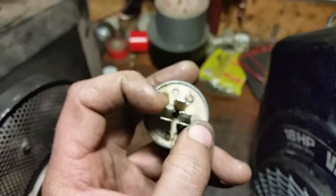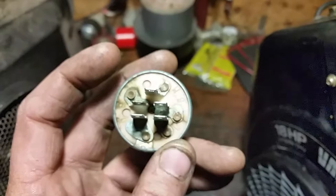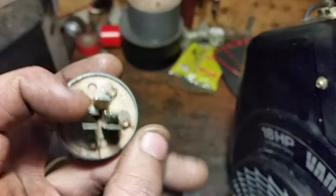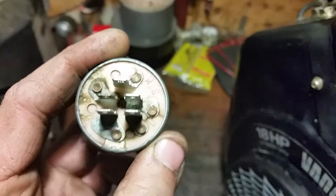What happens and where the problem lies is, while this is fine for the opposed cylinder engine, when we go to start up a Vanguard, we need power going to the light circuit at the same time we have the starter circuit live. When we go to the starting circuit, the battery and starter circuit is live, and then the light does not get power.